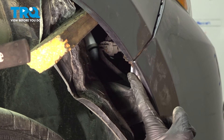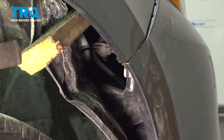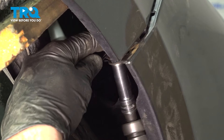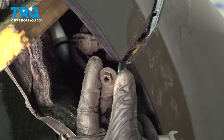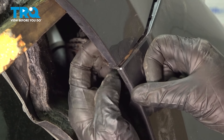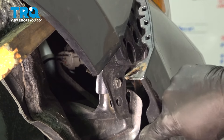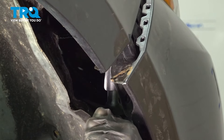Looking up in this area, you're going to find that you have an eight millimeter headed bolt that comes from the top down with a 10 millimeter headed nut. Remove the pair. At this point, you can take hold of your bumper cover, give it a wiggle, and start pulling it away from the fender. Let's pause on this side of the vehicle and do the exact same thing on the other side of the vehicle.